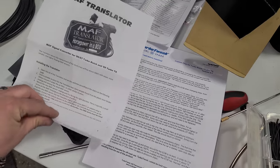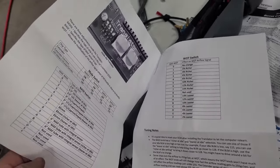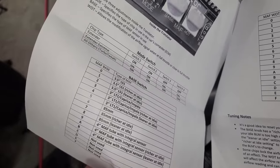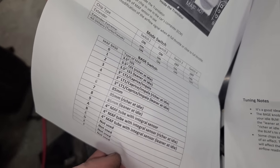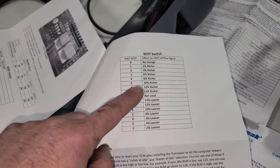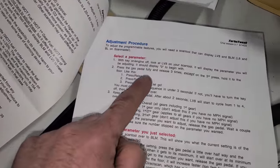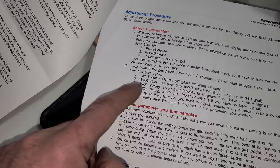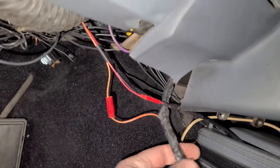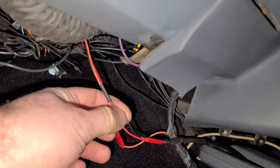Inside the MAF translator there are switches and knobs — a very old way of tuning cars before tuning software existed. We're selecting the 3.5-inch LS1 mass airflow sensor and using knobs to set idle richness/leanness, plus a wide open throttle switch. With the turbo tweak chip, we can do in-car tuning by pressing the gas three times and holding it to adjust wide open throttle fuel and timing. Here's our finished ALDL connector, rewrapped in factory tape. We have two power and ground wires powering all three added gauges when the key is on, and a harness that tucks under the A-pillar trim.